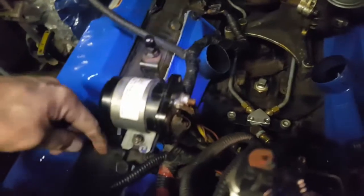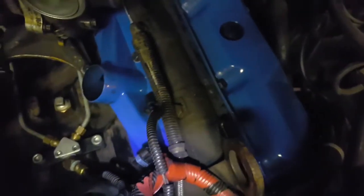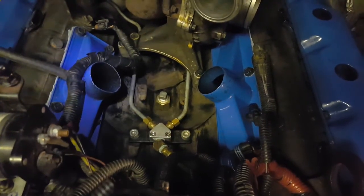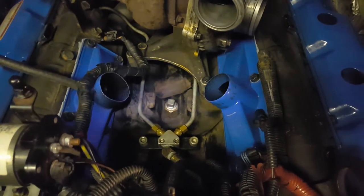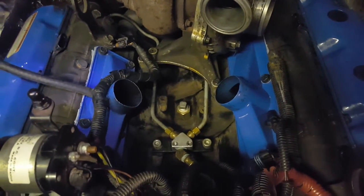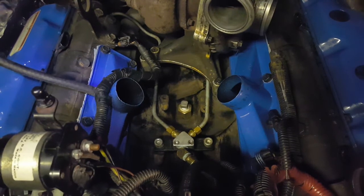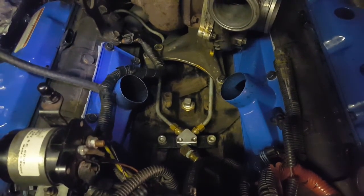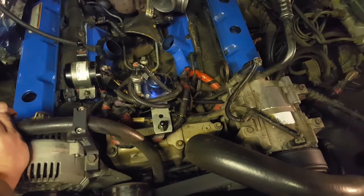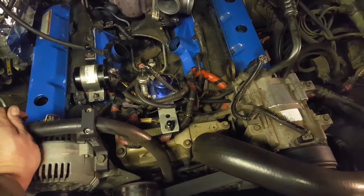I'm going to go one step further — I'm going to pull one of these rails in the oil gallery and start putting some oil in there. I had everything opened up and actually disconnected a high-pressure oil line to the head. It takes an awful long time for the low-pressure pump to pump that much oil up here to fill the high-pressure oil reservoir and both high-pressure oil rails. So I'm going to go ahead and just prime it — dump some oil in there to save a little cranking time. I'll crank it a bit more to make sure we got all the oil blown out, then pull these valve covers off again, put the glow plugs back in, recheck the torque on the injector hold-down bolts, and start putting things back together for the last time.